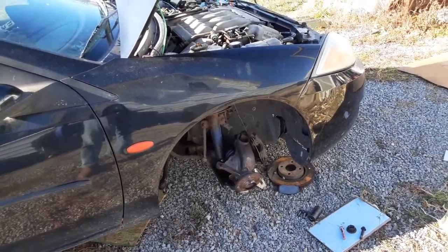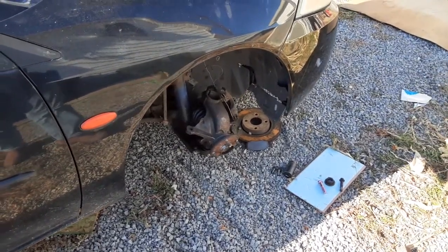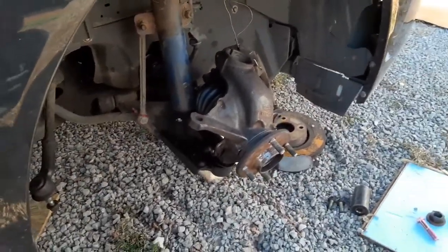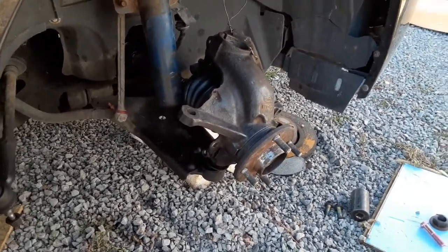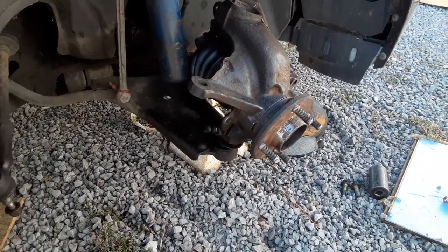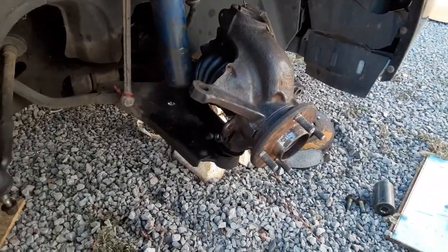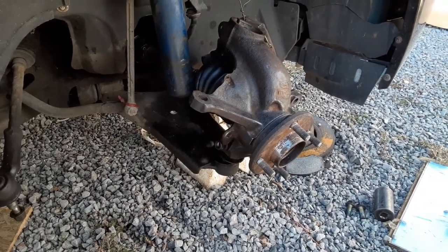In the process of putting this Cougar suspension back together, I started out making a pretty significant mistake. This is how I've been doing front suspensions like this in the past, on front wheel drives especially — I would set the hub back on the ball joint, the lower ball joint, and then reattach it to its strut, basically letting the lower control arm and lower ball joint take the weight of all this hardware.